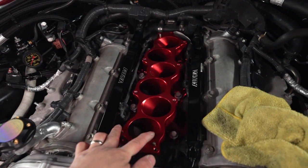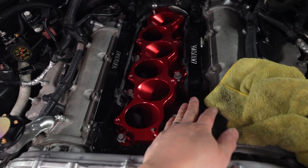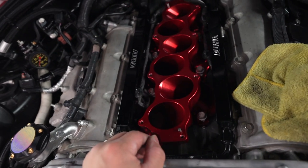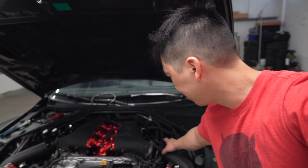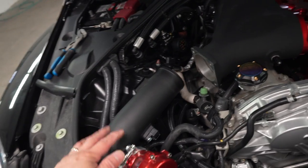So you do have to disassemble the intake manifold. You've got to take the lower runner out. And to clear, all you have to do is remove the fuel rail, move it aside, and then get it all in. And now I'm gonna torque them all down. Mounting it onto the lower runner, to the upper runner, I ended up having to take the throttle bodies off again, because it wouldn't clear the upper intercooler piping here. So I had to take that off, same as this side here.